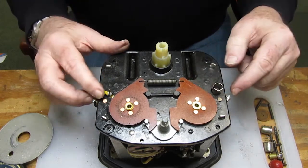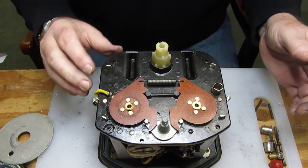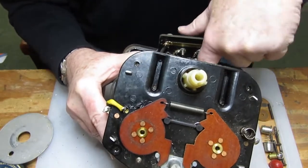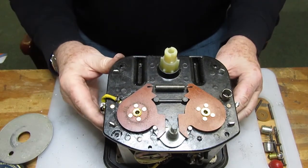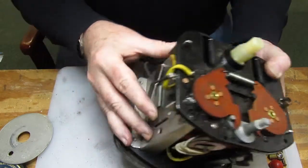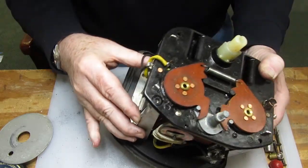If we're going to work on the inside, it's going to take an awful lot of effort. I generally like to just disassemble everything — take off all the wires and take this completely off — for the simple reason that you can't get at the machine adequately. For example, the power cord is all the way down here underneath and you just can't get to it. One trick of the trade is to take a photograph with your cell phone of the wiring arrangements so that you know where to put things when it's time to put them back. This unit has a bracket strap, so this must be a newer model — they changed the model a little bit in 1957.